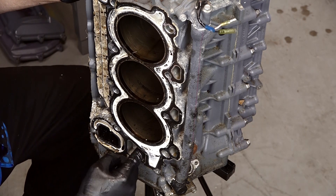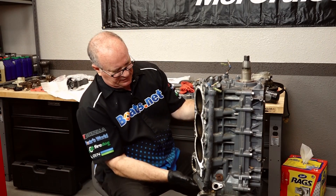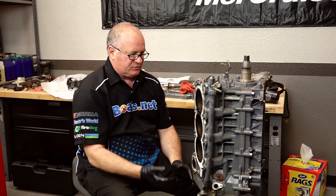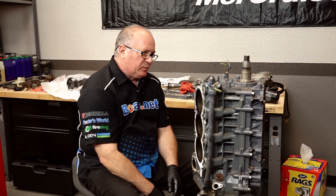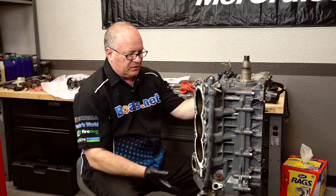What has actually happened is we can't see it without cutting it apart, but on the exhaust down at the bottom it is eaten so far it has actually gone into one of the oil passages. That's why when you tried to fill it up with oil and we were cranking it over doing the compression and leak down test, oil was actually dumping straight into the exhaust. So this block is trashed. I think we're gonna be able to reuse the crank — we'll pull that in a minute to make sure it's okay. Connecting rods look okay. I'm not gonna reuse the pistons so we'll be replacing those as well as the rings, and we'll end up just building it all from scratch.